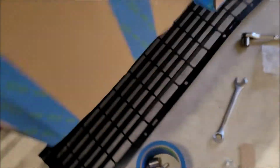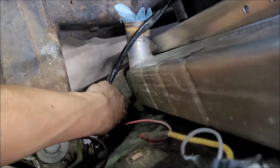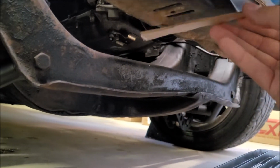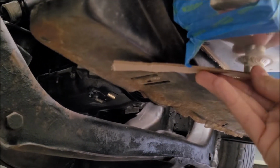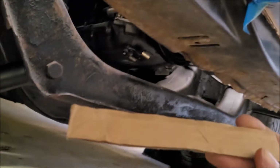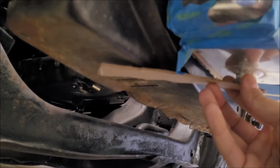And underneath, there's actually this flat spot next to the radiator down here that I'll drill a hole kind of in the corner, up through there, and get under here to show you. We're gonna go from the mounting point on the intercooler here right over to that flat spot, and I'll basically drill the holes first and double check my length, of course, and drill a hole on one end of this and see exactly where we're at before I mark the other end to drill.